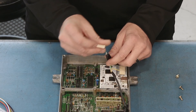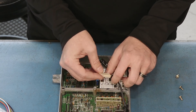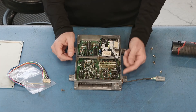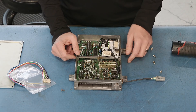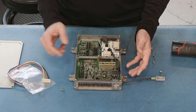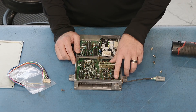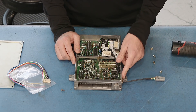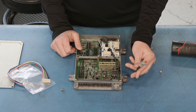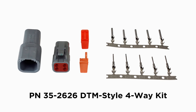Once that's all done, we simply plug this back into the connector port. We drill a hole in the side of the ECU, and after putting our heat shrink cabling and covering on the cabling, we ran the cabling through this hole, sealed it up with some hot melt to keep the elements out, and ran it to a 4-pin Deutsch connector.